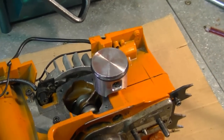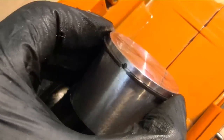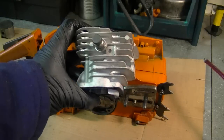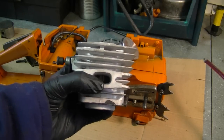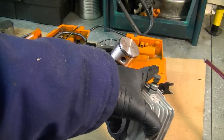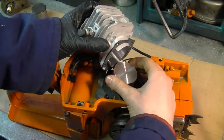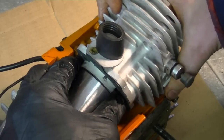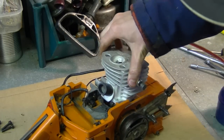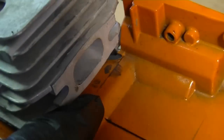When you insert the cylinder onto the piston, make sure that the ring is lined up with the piston pin. You're going to have to squeeze the ring — make sure it lines up with the pin and then insert the cylinder over it. Make sure that the exhaust port on the cylinder points toward the front of the chainsaw, and again make sure that the arrow on the piston is pointing toward the front as well. Now make sure your gasket is secure and lined up. Squeeze the ring on the piston and gently slide the cylinder down. Once it's all the way down, line up all four holes at the base of the cylinder to the ones on the crankcase.